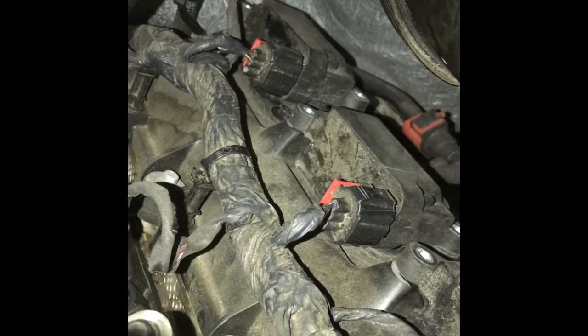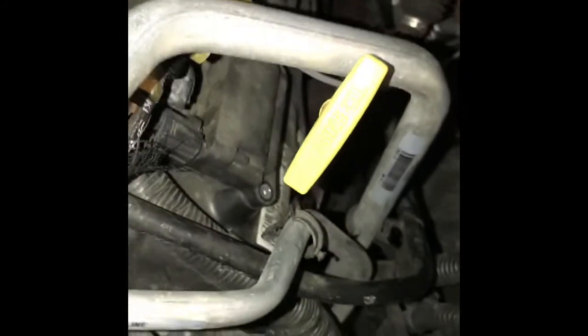Alright, next side. Okay, I got all the bolts on the right side taken out. On the front cylinder, you got the first two bolts you can use a 6 inch extension. You drop down to a 4, and you're basically freeballing with just a 10mm ratchet onto the socket, and it's just freeballing from there. I have all the bolts out.